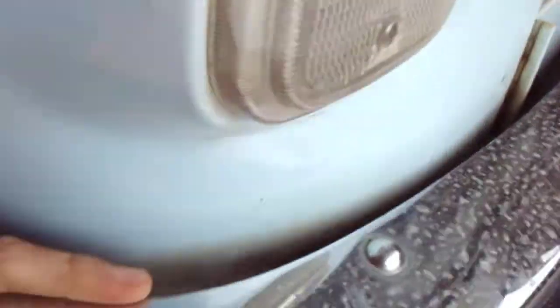Keep going along these seals. They do commonly rust along here as well, with the floor inside where the battery plate gets welded. Water gets trapped, so have a look at that. There's some filler there. Always have a look down here — always rust here. You'll see a bit of rust, something quite bad there.